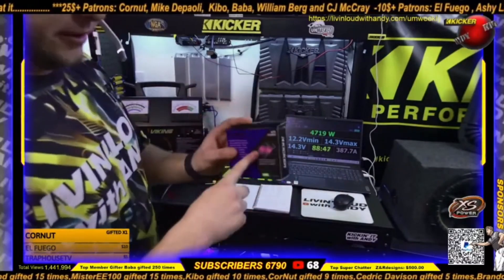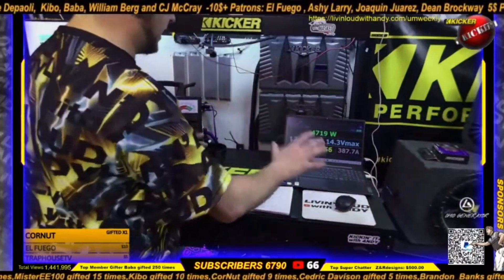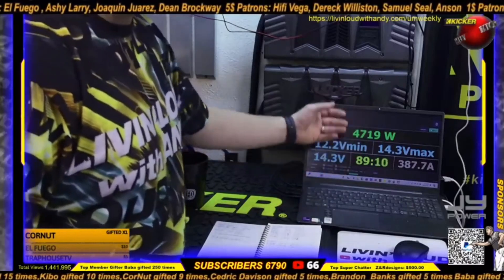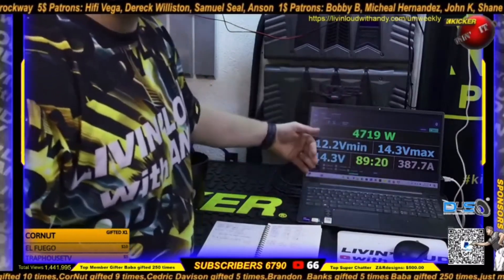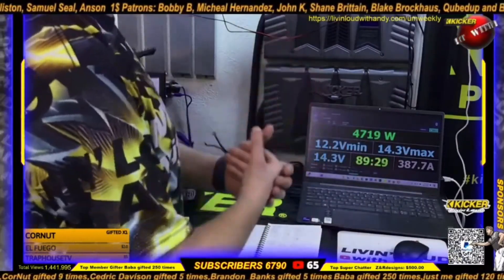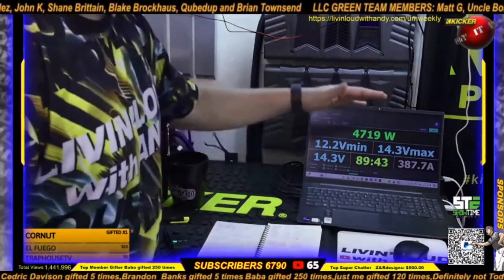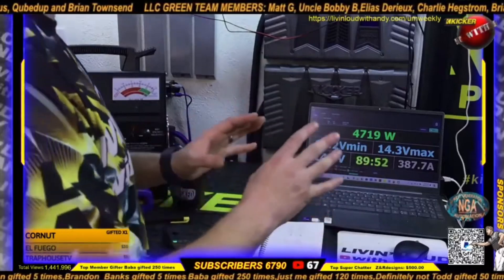With a 2000-watt amplifier you might think all you need is a 200-amp fuse — just double it to a 400-amp fuse. But if your electrical isn't perfect, current skyrockets to do the same amount of power. An amplifier at lower voltage usually won't do more power — it'll do less, unless it's regulated like some Kicker or JL amps. Your efficiency craps out, your current spikes because voltage is dropping, and because you're clipping — you turn it up more, efficiency drops further, making the amplifier waste heat and energy. That's why you melt fuses rather than blow them, and poor connections increase resistance even more.